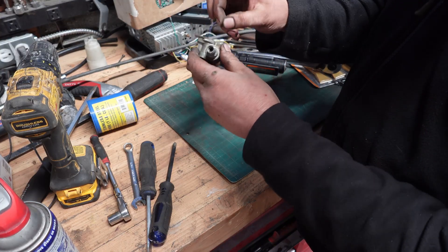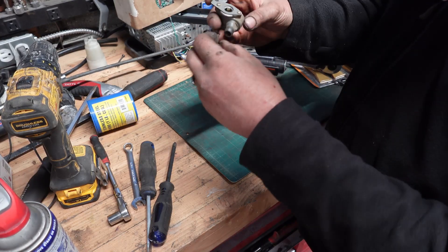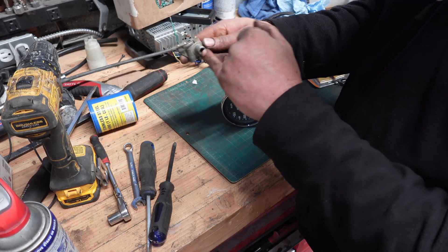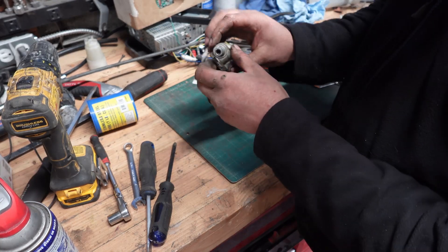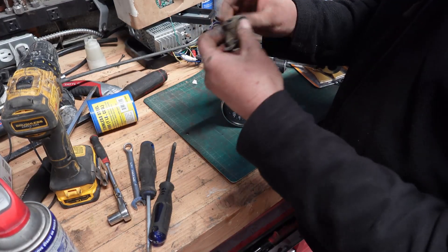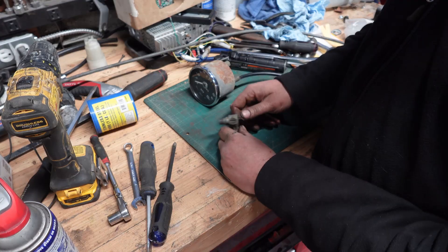So what we're going to do is clean this out — I'm just going to put a little bit of WD in here and work it real good. I'd say clean it with carb cleaner, but there's plastic in there and some plastics don't respond well to that, so I'd rather not kill this angle drive. We'll clean it out, lube it up, reinstall the speedometer, and then investigate that angle drive on the gearbox.